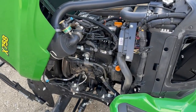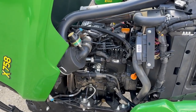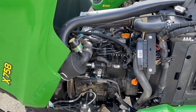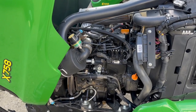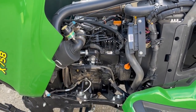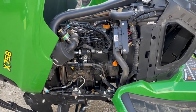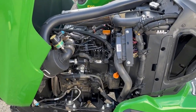These are a commercial engine, commercial grade, including the gas engine you can get. The gas engine is the second kind, and it's a Kawasaki V-twin engine. And these are all horizontal shaft as opposed to vertical shaft. They are shaft driven back to the transaxle, not belt driven like everything else.